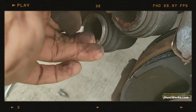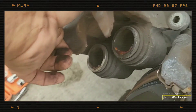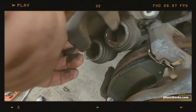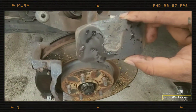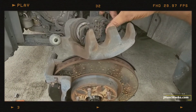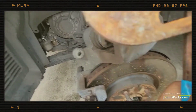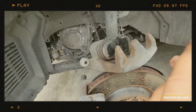So these two pistons — they have to get squeezed in so that the brake caliper can hug these pads, because they're thicker than the ones that were in there. I've got this on and I'm going to lay that flat on there, and the reason why I'm putting that over it is so it can get even distribution of force, so it closes evenly.